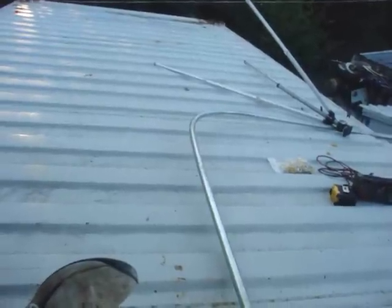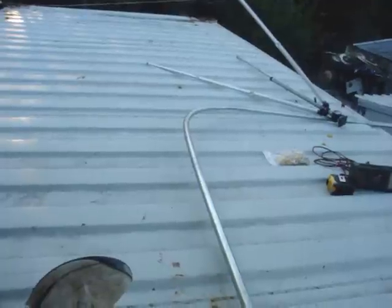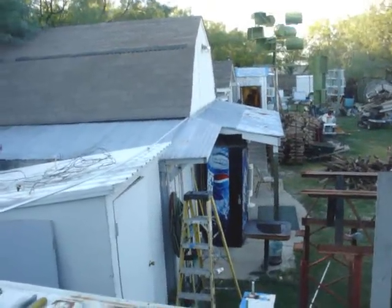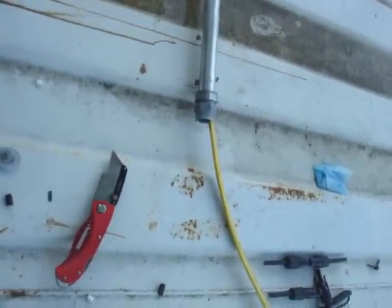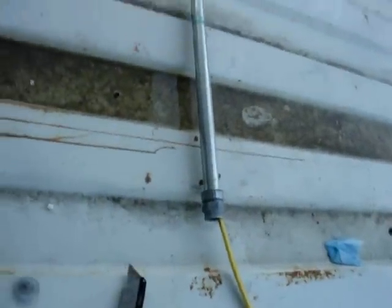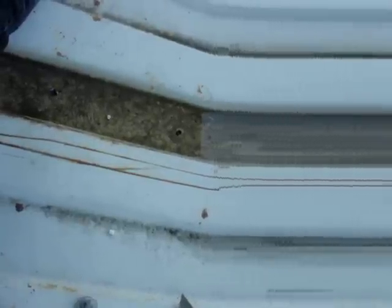There's something else I'll show you. I took a bicycle wheel, stuck it in the middle of the conduit run, and placed it between two of the rungs on a trailer. I pulled the conduit around the inside of the bicycle wheel so it made a nice curve — we didn't have the conduit benders handy, somebody had them on the job. The wire is already pushed all the way through and goes about another 10 feet past the awning. I've got to put a junction box here and another junction box here, then continue on to the next one. Many good things to you and yours — hasta luego.